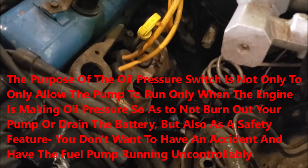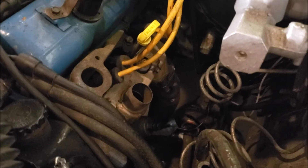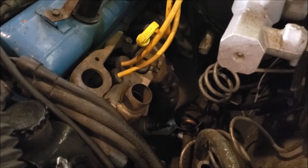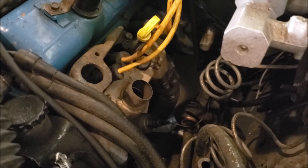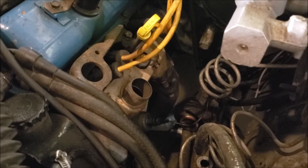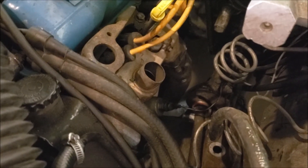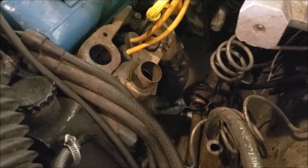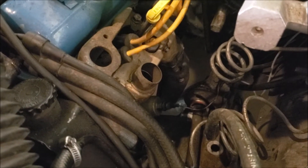What's the alternative? Holley makes one, Mr. Gasket, a bunch of people make them where they've got screw terminals where you can just spade the wire — but they're naked, wide open, unless you go get individual molded terminal ones. The Delco one I used is good. The only pain is it was too good of a fit — I literally had to get a little Vaseline on there so it would slide on, and it still took a lot of muscle.